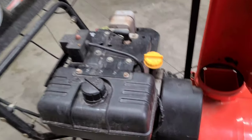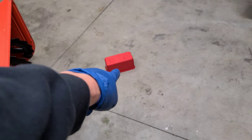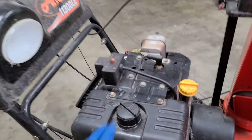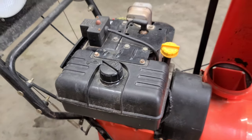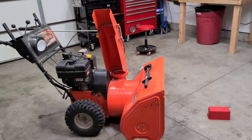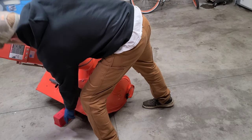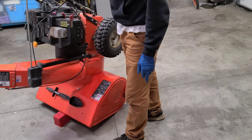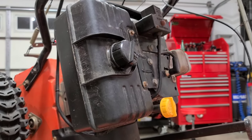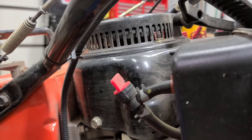This might be a good time to drain your fuel because we are going to be tipping this snowblower forward. I'm going to be putting the front of the auger chute right onto there so it's at an angle, which will reduce any gasoline that could potentially come out of the fuel cap. Watch me do the setup and you can do the same. I do not have any gasoline coming out of my gas tank, but be sure to inspect that. Sometimes you will start getting a leak from the carburetor. I do have my fuel off as well.